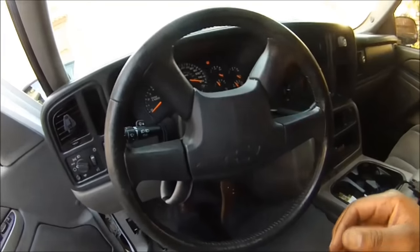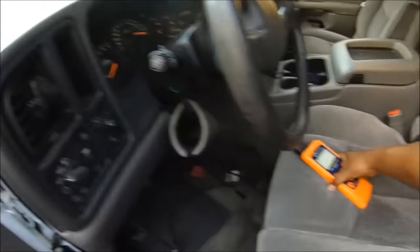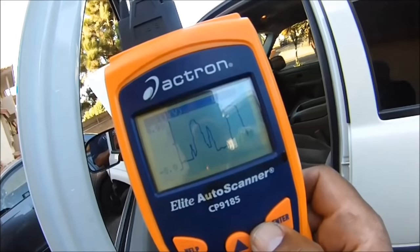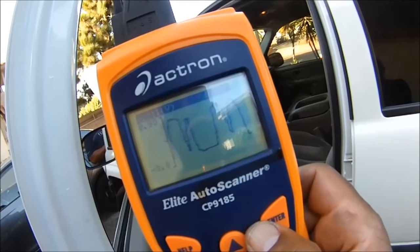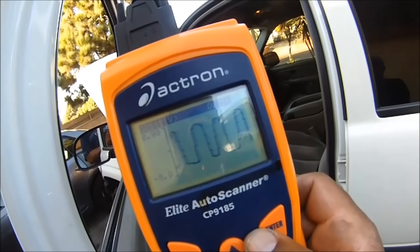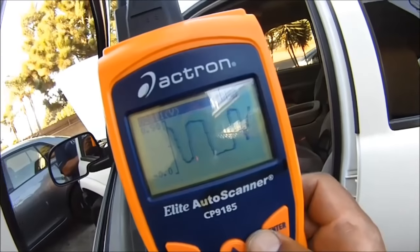Be careful when you do the brake torque test. Let me look at the O2 sensor. We're looking a little off — we still have an issue and the computer's trying to compensate. But I'm liking these readings way better than before. Looks like it's clearing up — big difference right there. These readings matter when you're diagnosing stuff. The O2 sensors — you really want to look at these things.